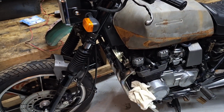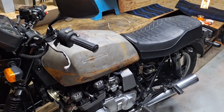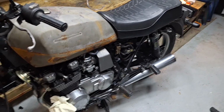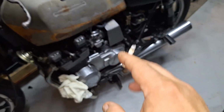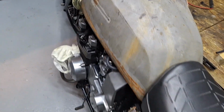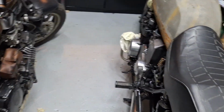And apart from the forks, the major problem is that when I put some gas on quickly on the throttle, it started dying on me, so it's lacking fuel, I think. So what I'm going to do is I ordered the set for the petcock, and I will change the membrane there and the O-rings and everything. So the main suspect is the petcock, as I'm pretty sure that the main jets are okay.